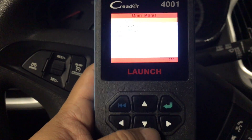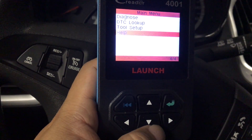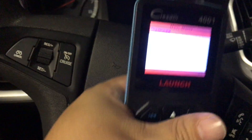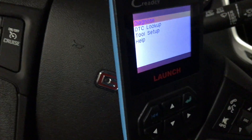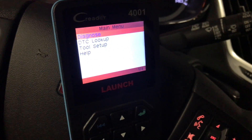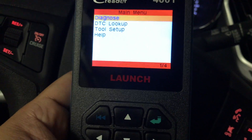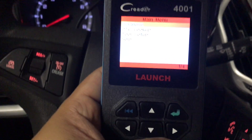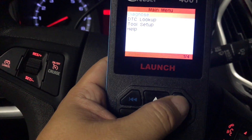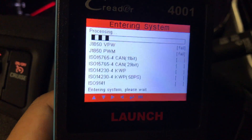Obviously you can navigate with the buttons, doing the manipulation here — enter and back. I'm just going to turn on the power accessory here. You don't have to start up the car, generally just power up. As far as I know there's nothing wrong with my car, so what I am going to do is diagnose it and just make sure there are no pending codes or anything like that. I'm going to hit enter — and look at this, pretty cool, entering the system.